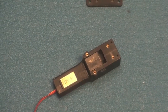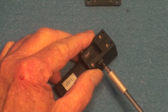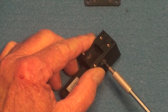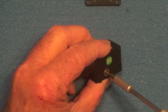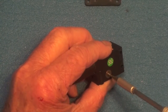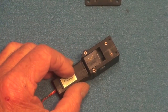Once the flange is off, what I like to do is go in and make sure that I've removed the grub screws — the 3mm grub screws from the trunnion pivots. These are the grub screws that lock the strut into the trunnion. I like to take them out because I don't want to keep them in the plastic trunnion when I take it out.